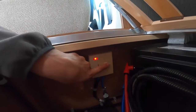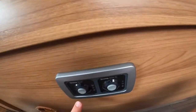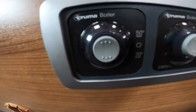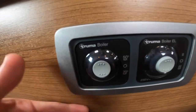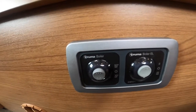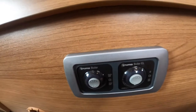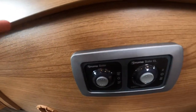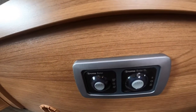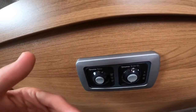You've got your fuse spur for the electric side to heat the water, controlled by the switch on the front. You've got two switches on the front: the Truma boiler for the gas side — where the cover must come off. You'll notice 50 degrees at the top for heating your water for showering, or 70 degrees at the bottom for doing dishes. The cover must come off; otherwise you get the red light, which means either you've run out of gas or the cover's been left on. Blow through the vent when you take the cover off to eliminate trapped gas, then you can return and put it back on. You'll feel the heat when it's working.